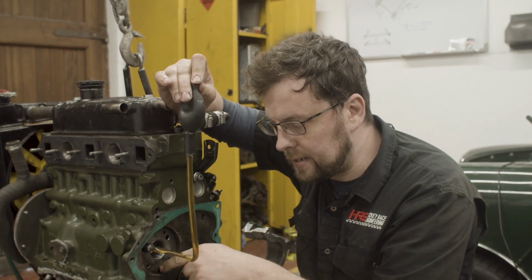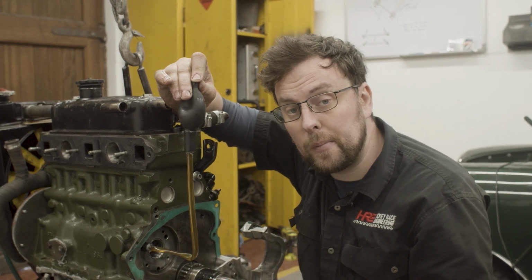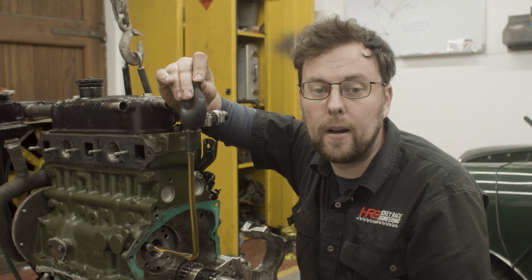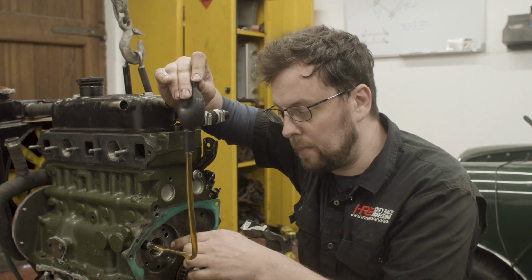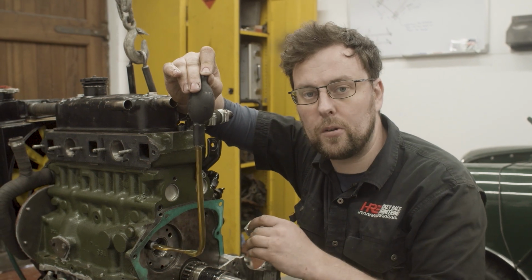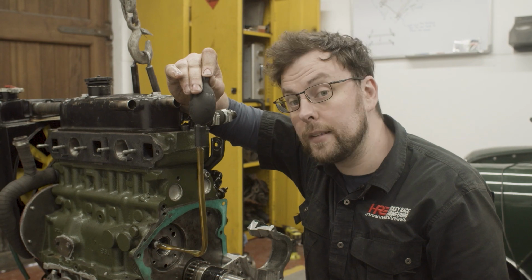So now we're down to only two possible reasons why this pump wasn't pumping oil properly. One, the gasket wasn't sealing properly here on the housing, or two, there's an elemental problem in the pump. So let's strip the pump, check the elements of the pump for wear, and if they're okay, then we'll replace with a new gasket. We'll temporarily put the flywheel and starter motor on here and we'll crank this over again and see can we get oil pressure to come this time.